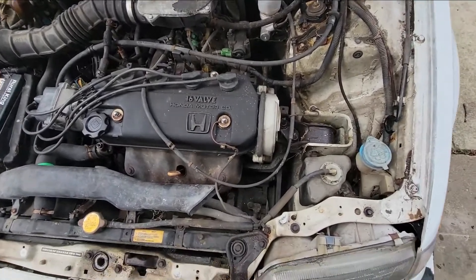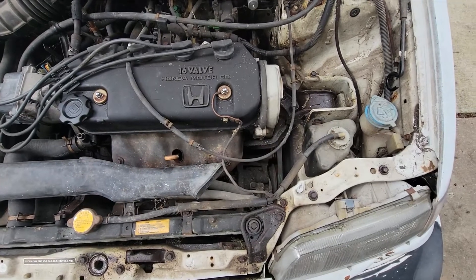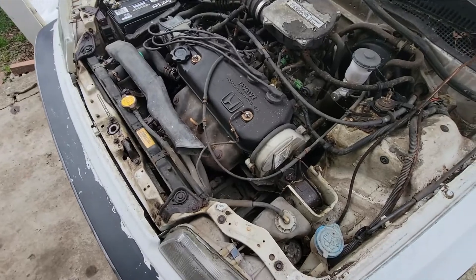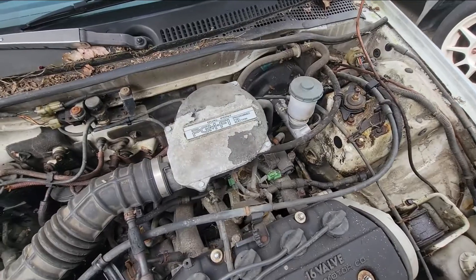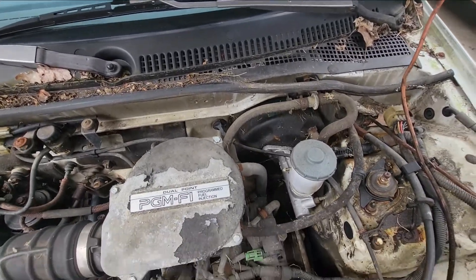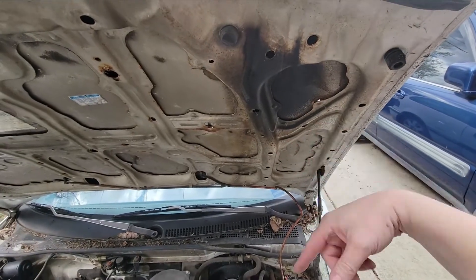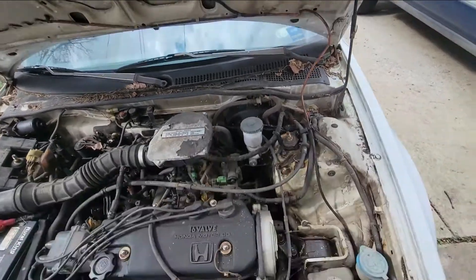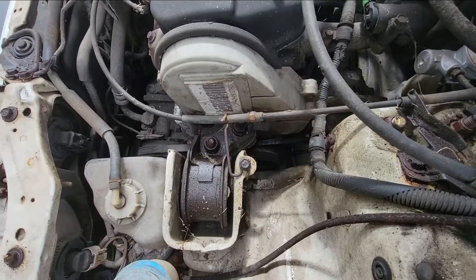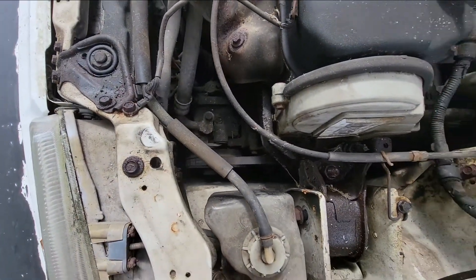As far as the AC, I'm not sure how that's going to work — if I have a bracket that will mount it, I don't know. There's no power steering so we don't have to worry about that. Looks like the brake master cylinder is new and possibly the booster. It looks like something's leaking because the belts are getting clung up on the hood and it's all oily around here. The alternator belt looks fairly new; the AC belt not so much.